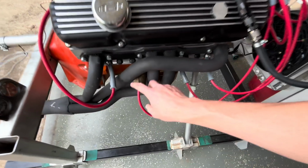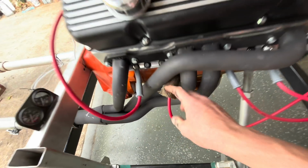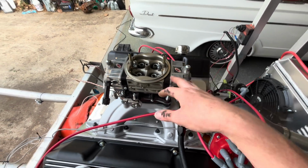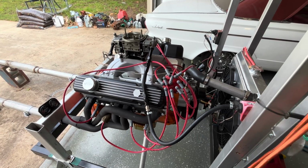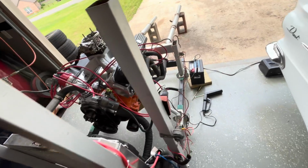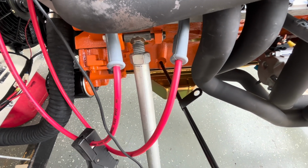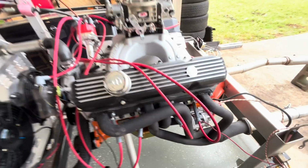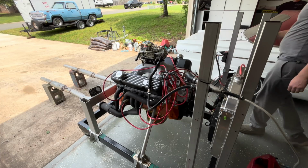But yeah, here it is. I went ahead and put this on. There's actually at least a 1/4 inch all the way around that. I don't know if you can see it or not. So I just want to protect his boot and be sure it's all good. And his 850 ATM carburetor, this is E85, so we'll see. It should be fine for us running it simply on a stand here. I'm not doing anything crazy and all that, but I can't believe y'all were going to let me start this thing without putting the dipstick in it. I imagine that 4 1/4 inch stroke crankshaft would have been feeding us a little bit of oil out of that hole there. So let me put the dipstick in and then we'll try to start. Here's our first real start. What's this like?